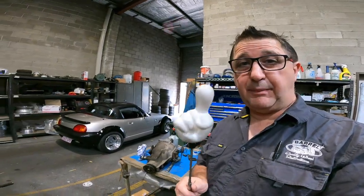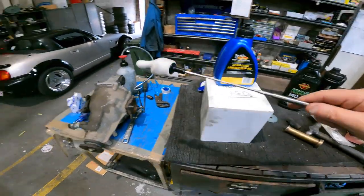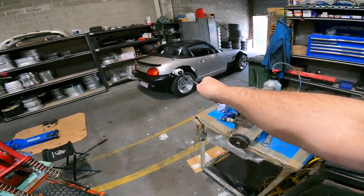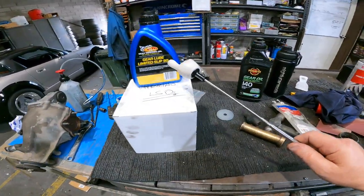We're still going ahead with the LSD. I'll record a bit more when we're in an 80k zone — it's not deafening but it's pretty loud, and it's on acceleration too. And here we are on the freeway at 100 kilometers an hour. So the plan is: we'll take the 90 weight out and put 140 weight in. Note: 90. Note: 140. A feeble attempt to try and shut it up, I suppose. If it doesn't work, it doesn't work.